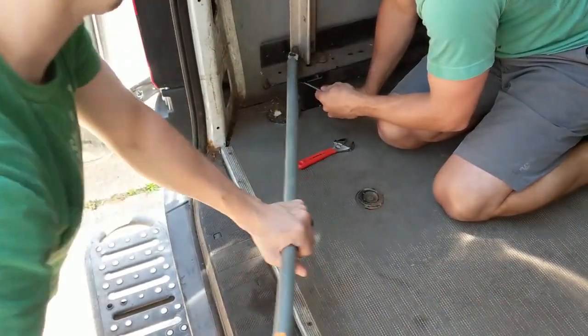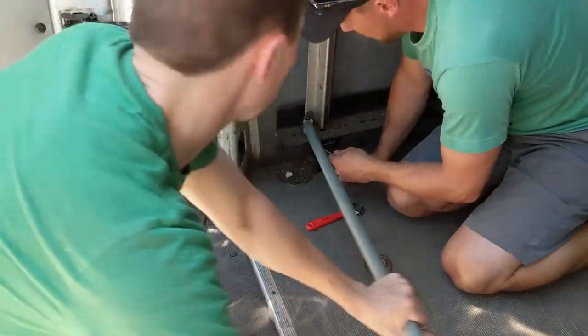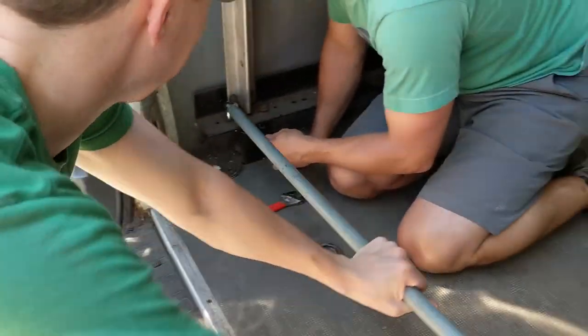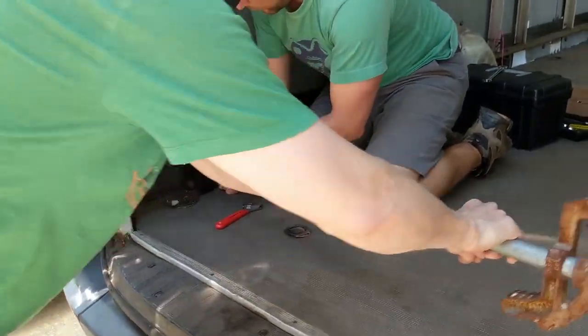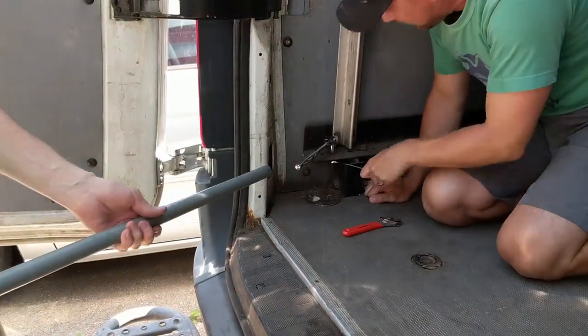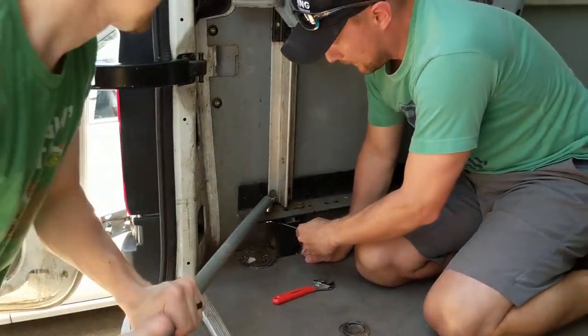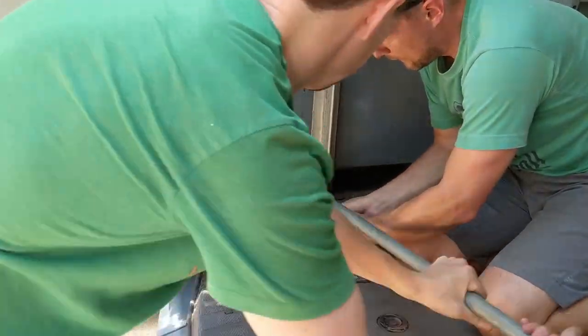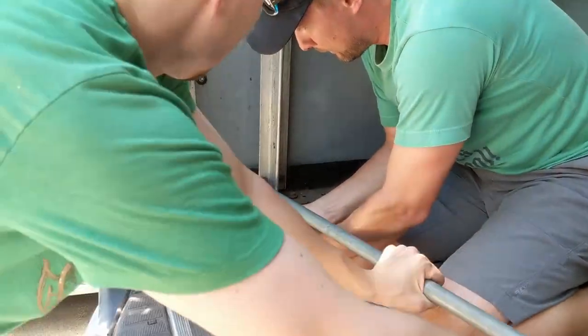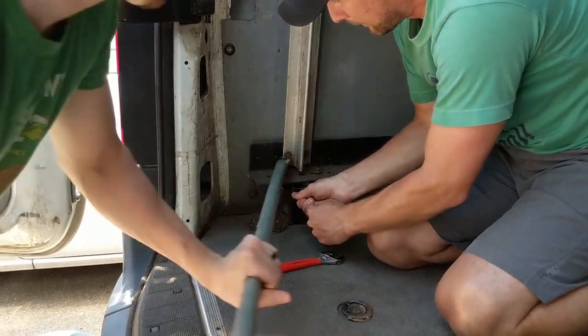Very sharp piece is out. I'm going to take — this is a lot easier. What's this for? Rusted screws? Yeah, this is for stubborn nuts and bolts. Need a socket wrench, a pipe, and another crescent wrench. Use the leverage of the bottom part against the van so you don't have to hold it as much.